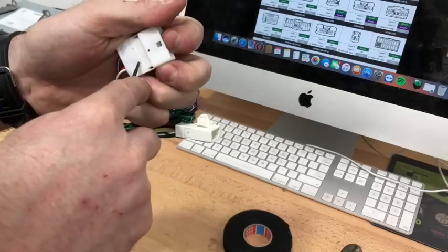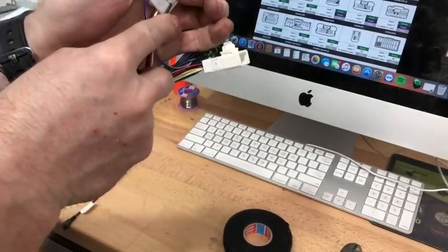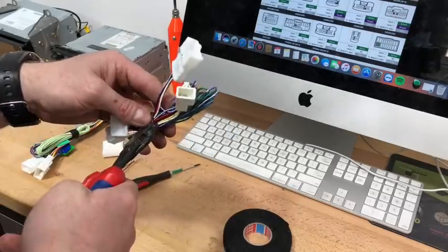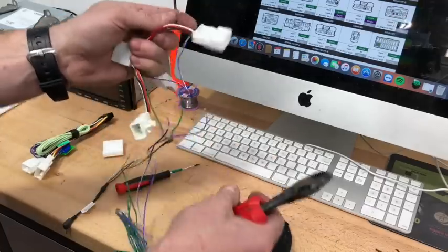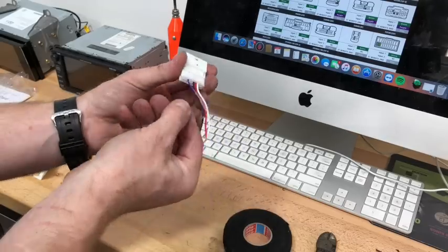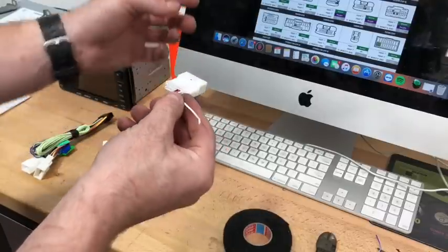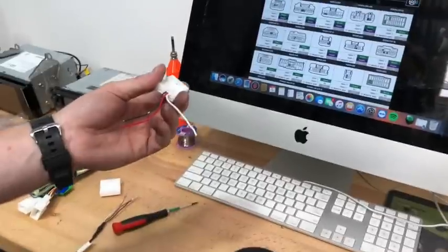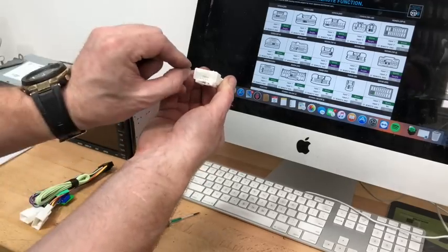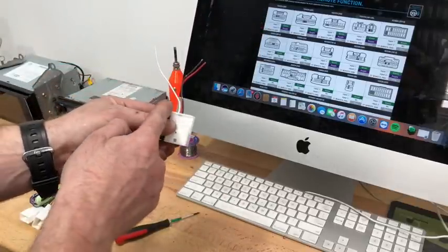You can get this loom from us. The 28-pin is typically for newer vehicles, but we need the 20-pin for these 2005-2010 Toyotas. We're going to de-pin this plug. Looking at the diagram on the website — that's the back side of the male connector — you've got three pins in the top left. So the order going in is going to be gray, green, purple.